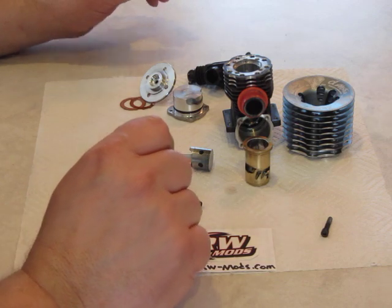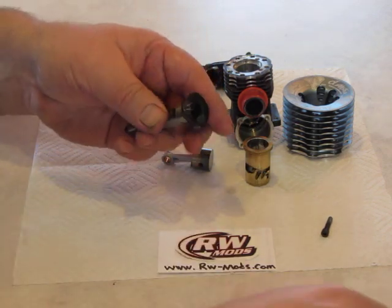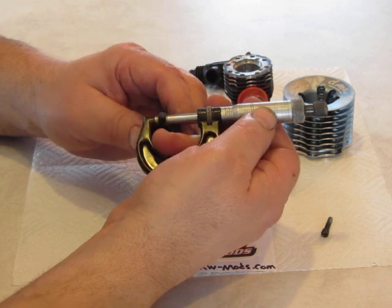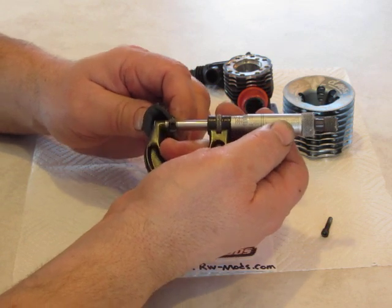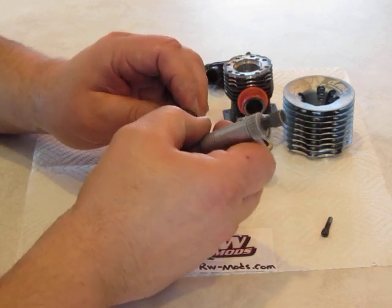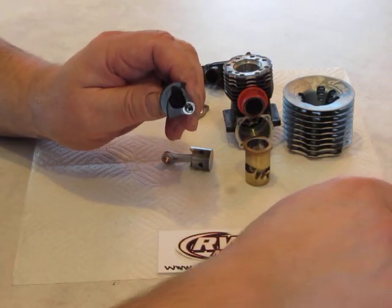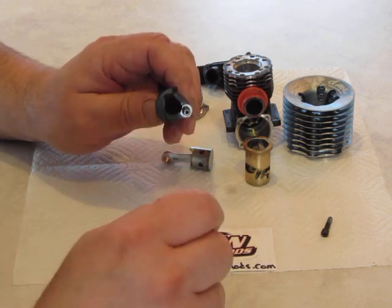The first thing I look at when I take an engine apart is the crank pin. A micrometer is the best way to check it. Calipers can give you an idea of wear, but you want to check all the way around the crank. The wear will always happen on the thrust side as the explosion pushes the crank down — it might measure good one way but be worn the other way.